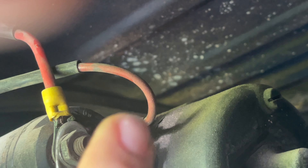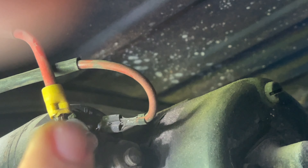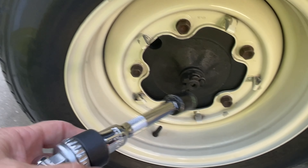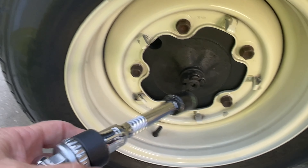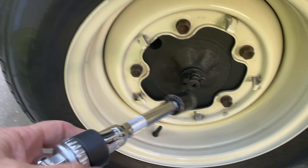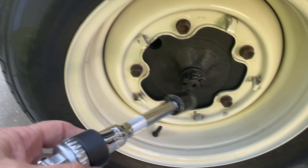Get in here and clean all your contacts with sandpaper — the battery cable and everything back there. Putting the starter in is just the reverse of what you did to take it out, so make sure all your connections are clean, get everything bolted up nice and tight, and don't forget that 17 millimeter nut up in your engine compartment. Reconnect your battery and give your car a start. Once you get your wheel back on, torque it in a crisscross pattern at 81 foot-pounds. That's all for today's video on how to remove a starter in your air-cooled VW Beetle — thanks for tuning in, see you next time on DubWorld.